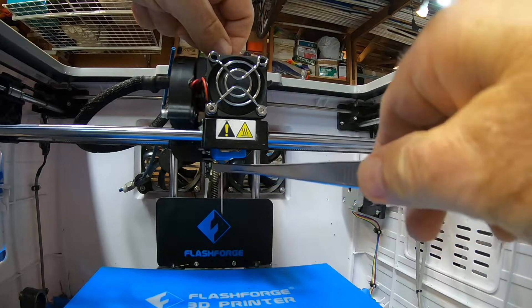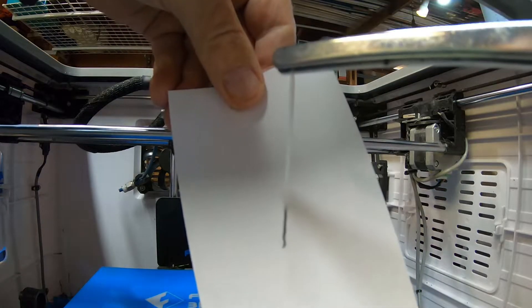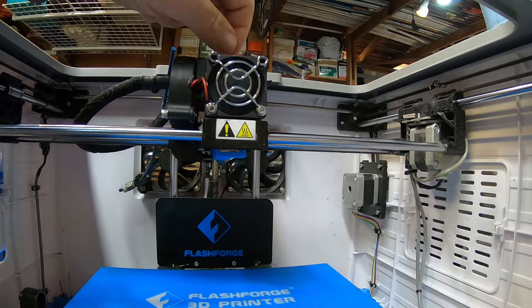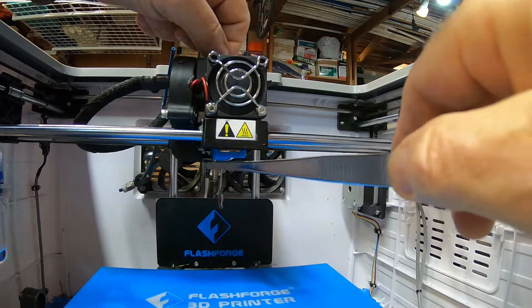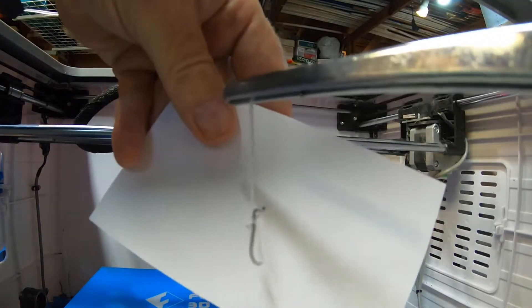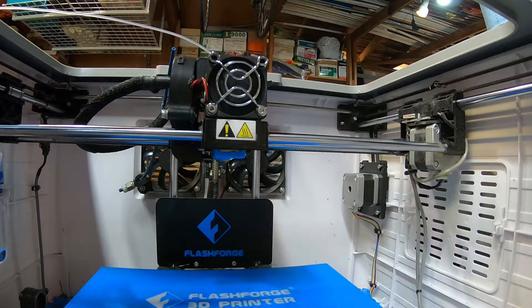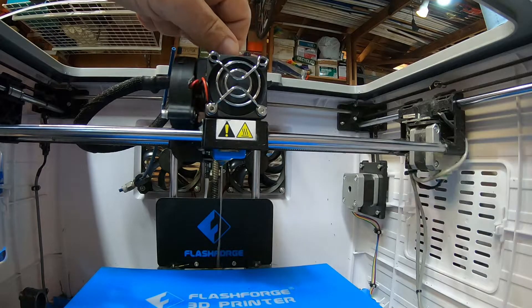You can see that black on the end with a white card behind it — that's the PETG that's still in there even though we cleaned it out. We'll run this for about a minute or so. See — every time we start and stop it, more comes out. When it's running continuously it doesn't seem to get a lot out, but when you start and stop, more comes each time. Keep doing that until we don't get any black at the beginning of the loading cycle.